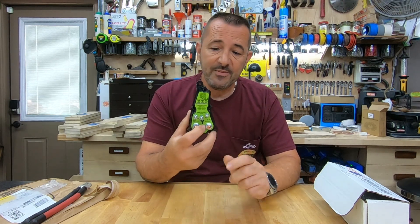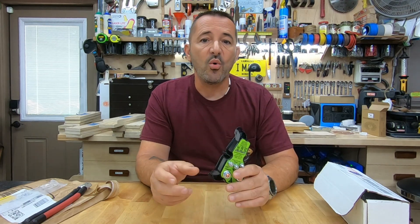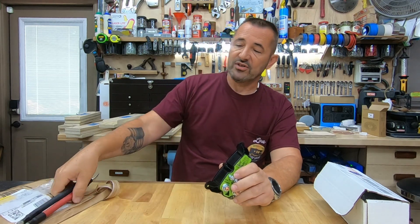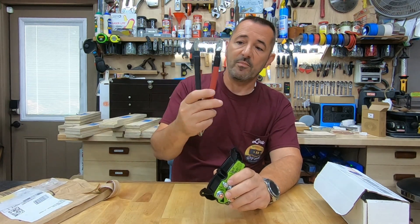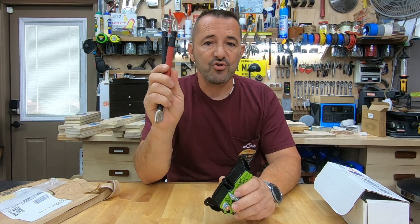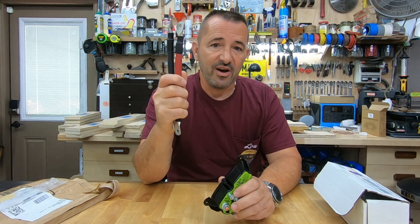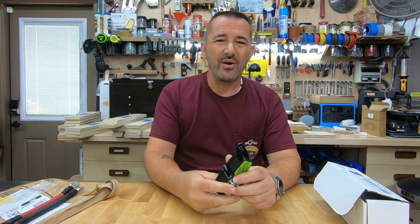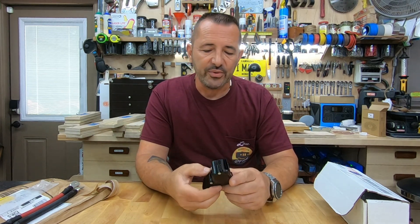A lot of people may have the newer style BIM and it'll be a direct swap out. I don't have that style — I have an old-fashioned circuit board and Trombetta switch that's going to have to come out, and the new one will have to be mounted in a small space. I bought some 1/0 cable — black and red — because it was half the price of two red. I got both of these on Amazon and I'll leave links below, and I'll also put it on the blog article I'll do with this.